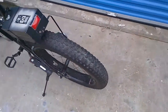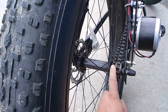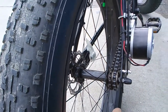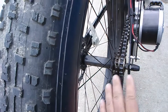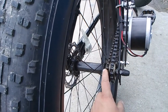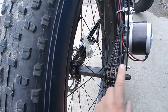The first thing you're going to want to do with your fat bike is find yourself an extra freewheel. I tried to get one at Revolution Cycle here in Edmonton, but what they sell for freewheels is just kind of junk and won't work properly with the fat bike configuration and the dual freewheel adapter. The freewheel I installed — before the diamond freewheel that came with the kit — is just off an old BMX that I pounded off with a punch. Then I installed the freewheel adapter and then the diamond freewheel.